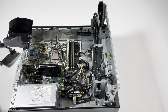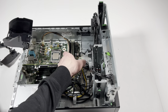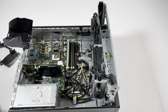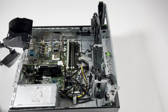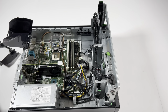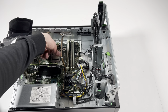To remove the CPU, take this clip right here, lift it like this, and it comes out with the CPU. Gently lift it up — this is the i5-6500. I've got some thermal compound on my hands so let me wipe them off. The CPU I'm installing will be an i7-7700, 7th gen. You can install it the same way — there's only one way — and clip it in.